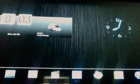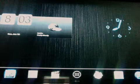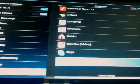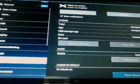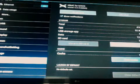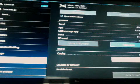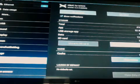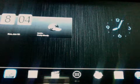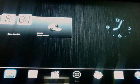It is also recommended to clear the cache on XBMC maybe once every month or so. To do that, go into Settings, down to Apps, click on XBMC, and here you have Clear Cache — just clear that and it'll reset XBMC to a fresh state. It's recommended to do it every four to six weeks. Don't clear the data as that will wipe the apps off it — just clear the cache to keep it running smoothly. If you ever need to reboot the box, just hold the power button, this menu will come up, click Reboot, and the box will reboot.